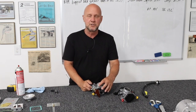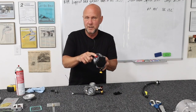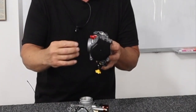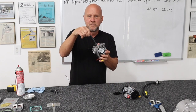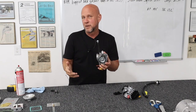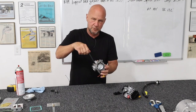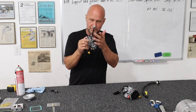The other thing that got changed: I just made these FlexiJets, because this stuff is hard to get to. On the new frames — whether it's the two-strokes or the four-strokes — to get your fingers in there to change the idle, it's not that easy. The FlexiJet works on all bikes 2017 and newer with this newer-style throttle body. It's great for the new-style frames. If you turn it too far it's still going to be hard to turn, but it's still easier than trying to get to that directly. For a small price, this could definitely help you out.